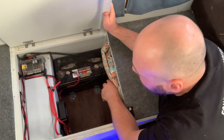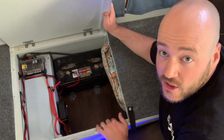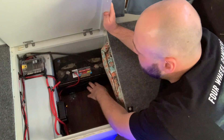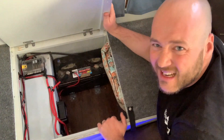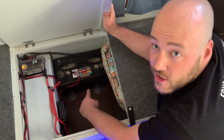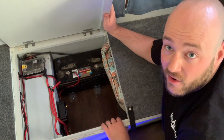Next up, that is hooked into the charge controller. This is the Overland Solar MPPT-115 charge controller. The folks over at Four Wheel Campers sent this out to me to help out. Off this charge controller, the only thing we have is that it runs up to the solar — we'll go to that in a second — and then it runs to the battery to charge. I've got two wires; I think it's 10-gauge wire, or maybe even 4-gauge. It's a nice thick wire that runs to the battery. So it's coming off the charge controller's battery outputs to the battery to charge it. That's always hooked up, and then just hooked up to my solar panels on the roof, so pretty much anytime the camper's in the sun, she's pulling down a little bit of charge.